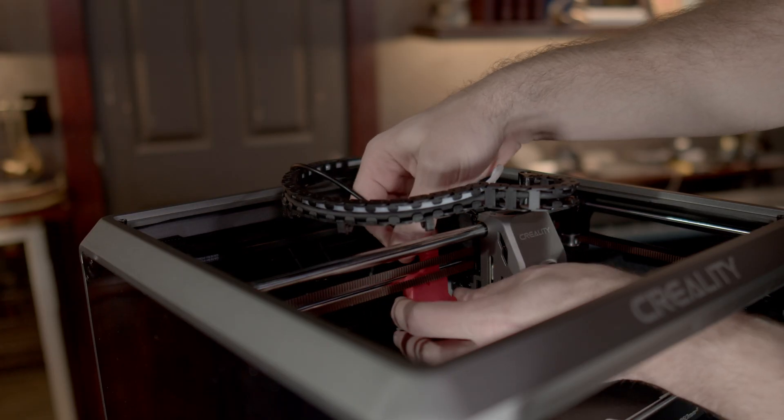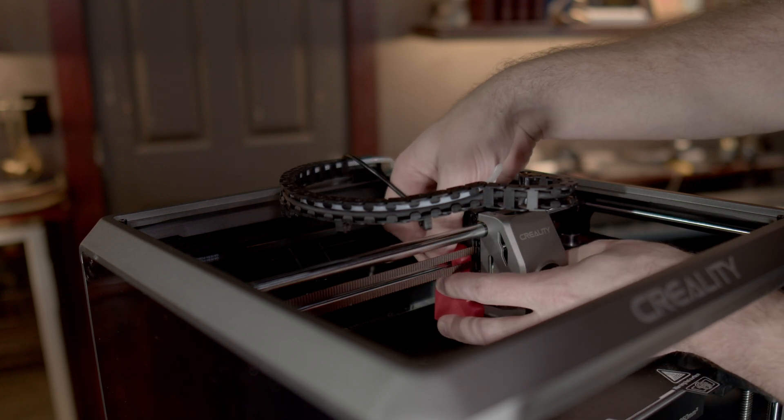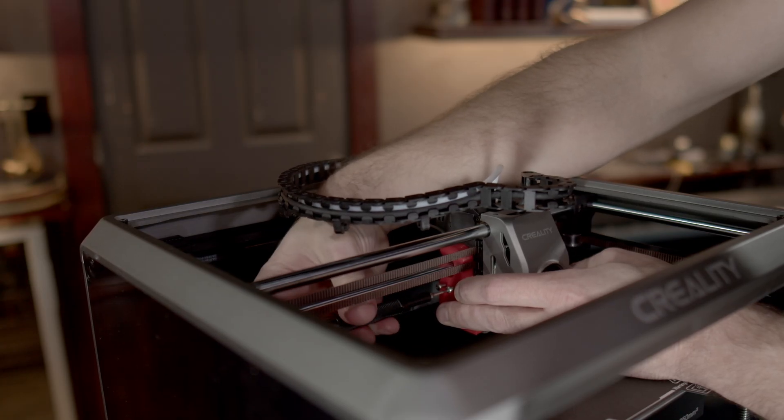To install the probe onto the tool head, all we need to do is slide it in between the belts and the rails, rotate it to index it onto the knobs for the lidar, and then screw it into the side of the tool head. These screws are included in the Creality extras box. In this video I won't be showing how to route the USB cable through the rear channel to the bottom of the printer - the USB cable provided in the box doesn't have the shielding required, and the EMI from the printer is too much. If you want to run a cable through the rear channel to the MCU, make sure you get a heavily shielded cable.